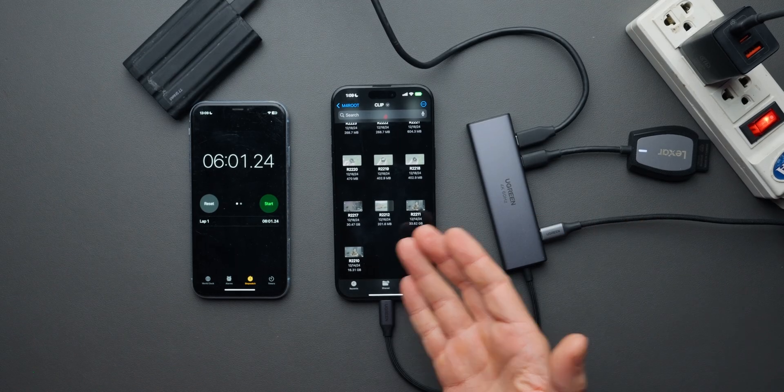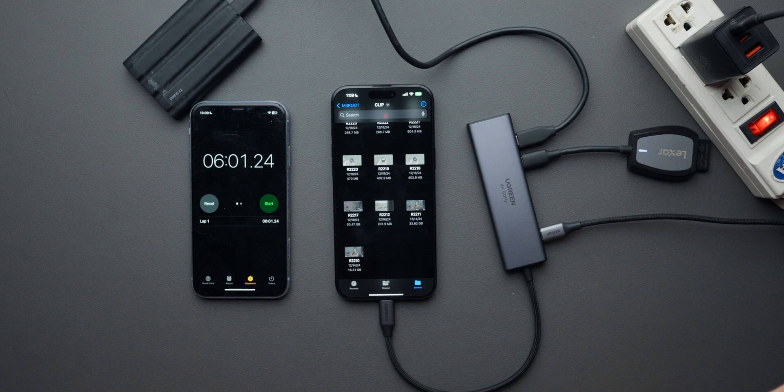This is super fast. If you had a USB-C hub with a UHS-I SD card reader built in, it would have taken much longer — probably twice as long, or even two and a half times as long. So if you are using UHS-II SD cards, it's absolutely worth buying these accessories to benefit from the fast transfer speeds, because otherwise why would you pay so much for a fast SD card?